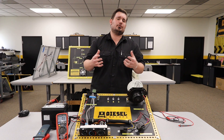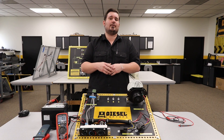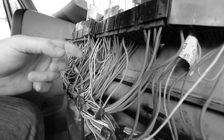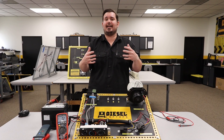Now, if you go into a fuse panel and you're checking an amperage measurement, let's say on one side of the fuse you have your power feed — one single wire — but on the other side of the fuse, maybe you have three wires coming off of that fuse. If you go around all three wires, then you're checking every component in that circuit.